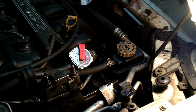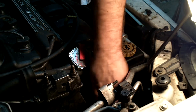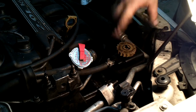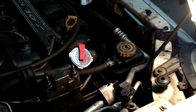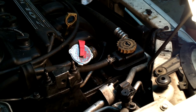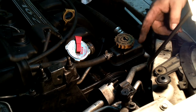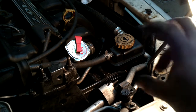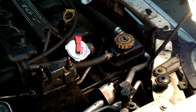We're gonna remove the power steering pump. It has three bolts holding it — one straight top dead center that you have to go through the pulley holes. Now that the engine is free to move, we can jack it up so I can get my wrench and socket in there for that lower hole. When I get it out, I'll show you the alignment of those holes so you'll know what to feel for when looking for those bolts.